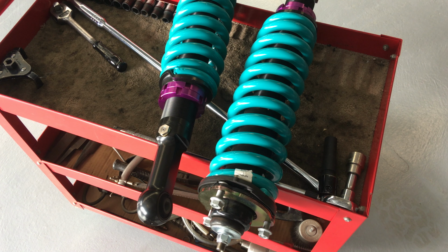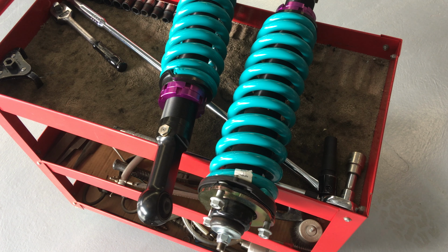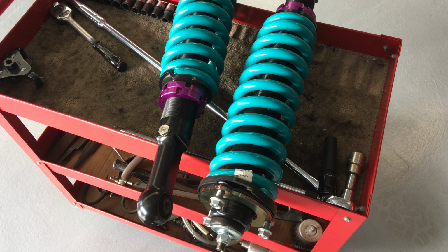But by doing so, let's say for some reason you wanted to get an extra 30mm at the front. I want to go 30mm higher. Don't think that by adjusting this 15mm, you're going to end up with exactly 30mm. Other factors need to be taken into account because as you raise the vehicle, it shifts the weight front or rear, depending on what you're adjusting. And then by shifting the weight, it also adds or subtracts to the height you're going to have, right?